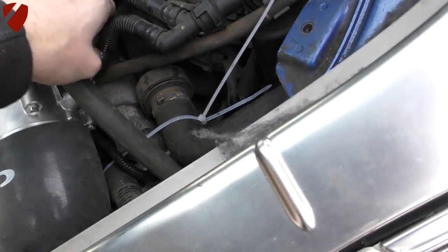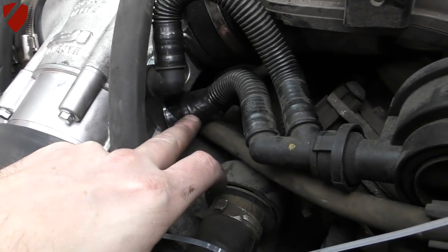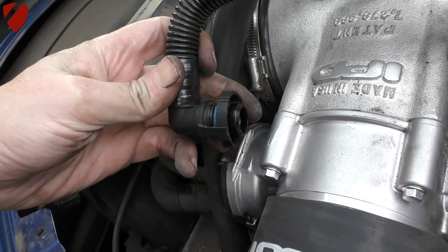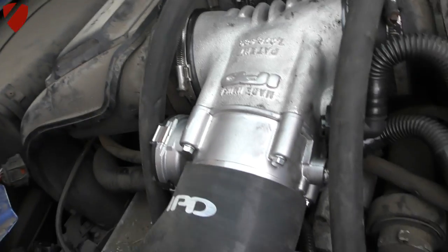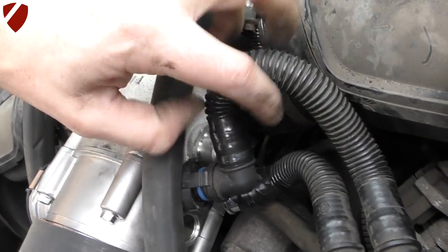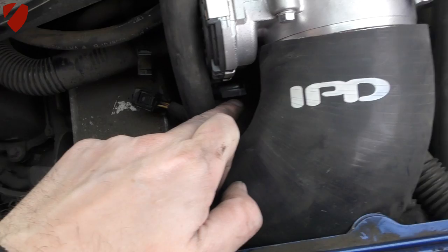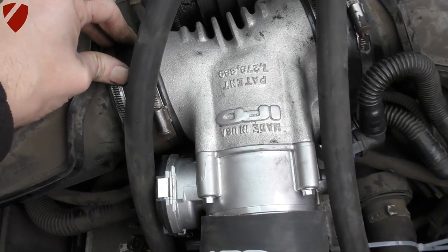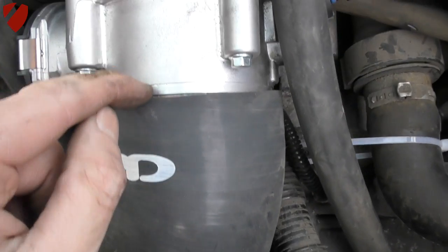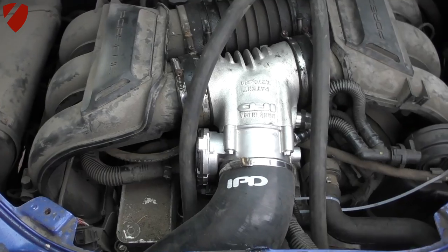This vent here — you've got two of these going into the AOS. This blanking piece actually snapped, so normally it would go over there and you'd blank it off with the blanking plate provided, but since it snapped I've blanked it off further up the line and surrounded that with insulating tape. The electrical connection for the throttle body will plug in once everything is lined up. The main problem right now is that it's just not quite lining up to where it needs to be, but I'll keep working at it.